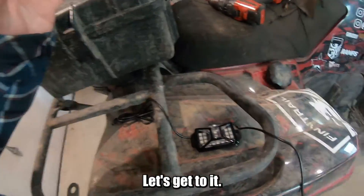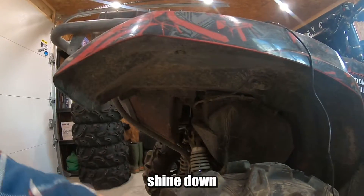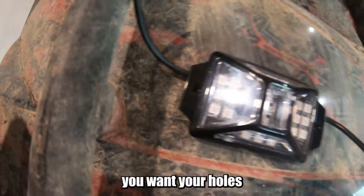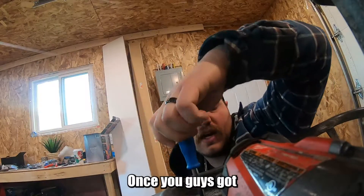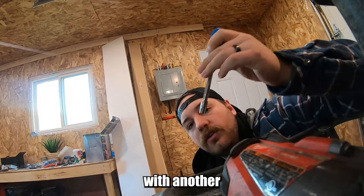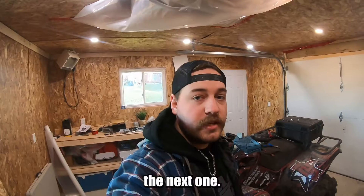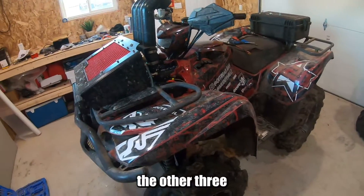Okay, how to install your rock lights — let's get to it. You're gonna find out where under your bike you want your rock lights to shine down, and you're gonna put them on the top side so you can get a marker and mark right where you want your holes. Then you take your drill bit and drill holes for your screws. Once you've got your holes pre-drilled and your lights put up, you can tighten up the little nuts with a seven socket. There you have it — first light installed. We're gonna jump to the other side and install the next one, then I'll go ahead and install the other three lights on my quad.